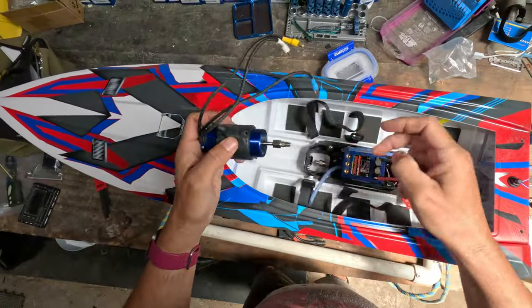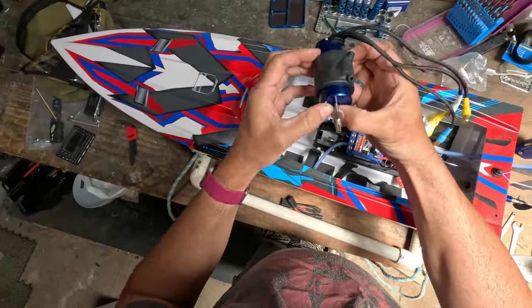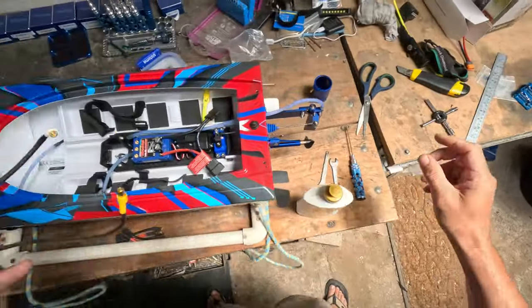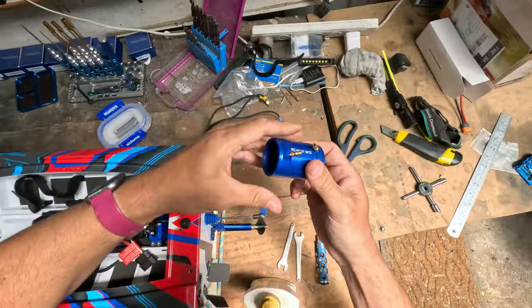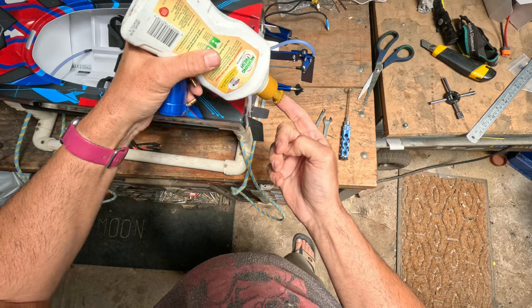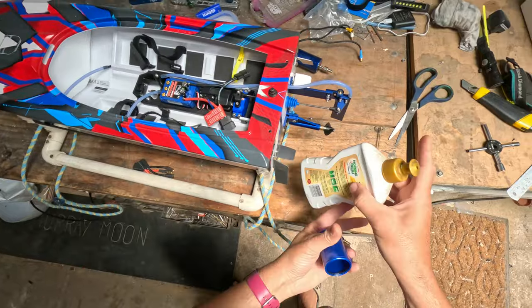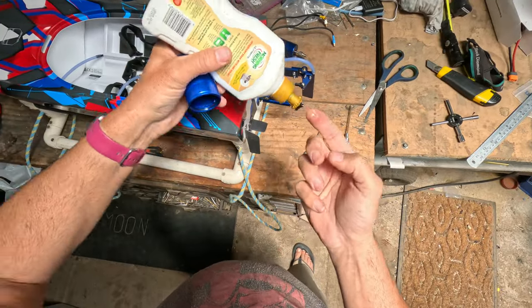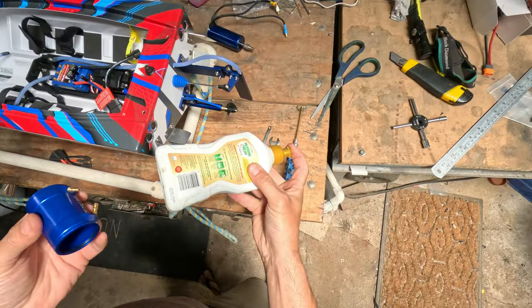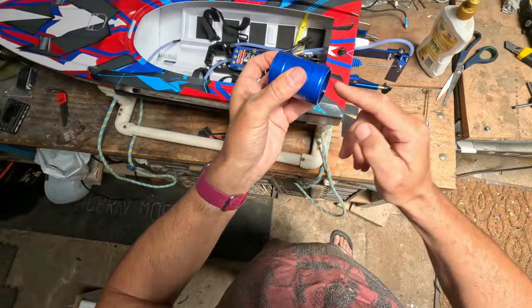The only reason they're a bit hard to put back in is just lining up the bolts where you can't really see. So get rid of this old one and put the new one on — it's already got the O-ring sitting in there. Dishwashing liquid makes them slide on nice and easy. It's better than using oil or CRC-type spray because those are petroleum-based and affect the rubber.